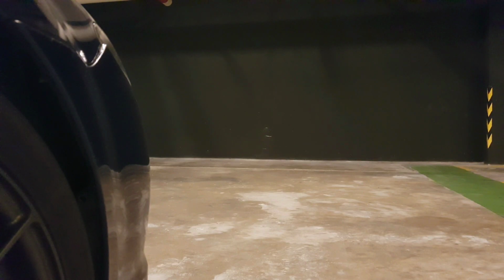Okay, welcome back guys. As I mentioned in the previous video before the cut off, I'm currently in a pretty dark basement in Setia Alam in Malaysia. What I'm going to show you is me switching on the headlights that I have on the car. These are bi LEDs, and they do flick on instantly compared to halogens and HIDs. HIDs take time to warm up, and you can't use them in high beam if you want to flash oncoming traffic to warn people. Halogens just don't make the cut, they're not that bright.